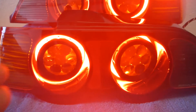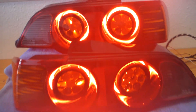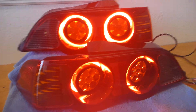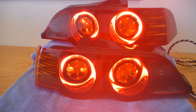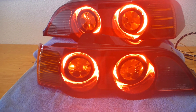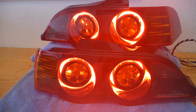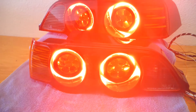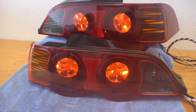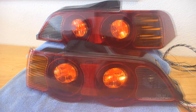Those HI lens running lights would probably be bright enough in normal nighttime conditions — after all, it is daytime right now. The halos give a way more intense look; it's just a really cool effect. To me, this should be the parking slash driving light. For the brake light, those dual intensity halos just go significantly brighter when you push the brake — brake light on, brake light off, real simple and elegant. Alternatively, he could use the HI lens as the running light and the halos as the brake light, but it's totally up to him how he wants to wire it up.